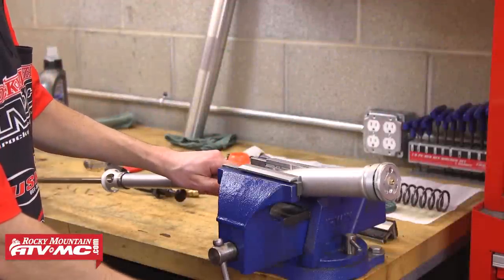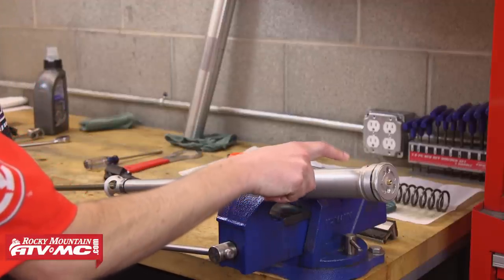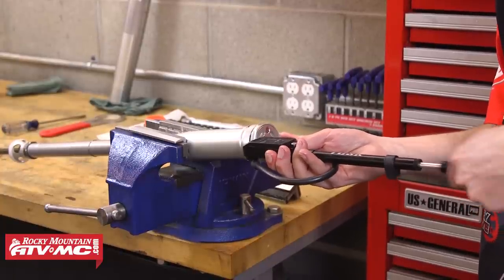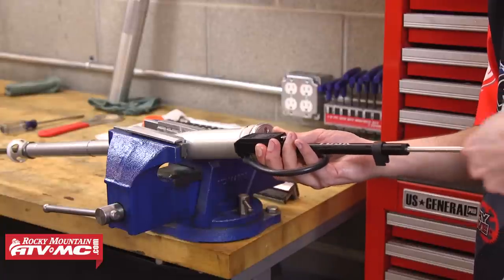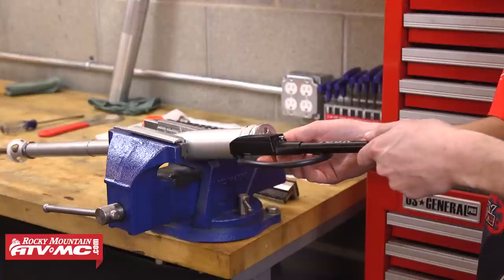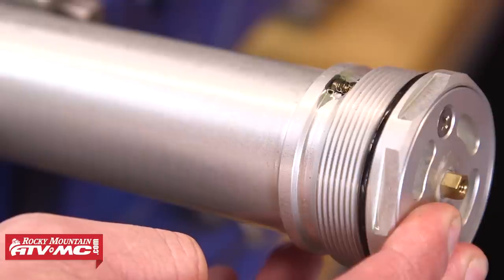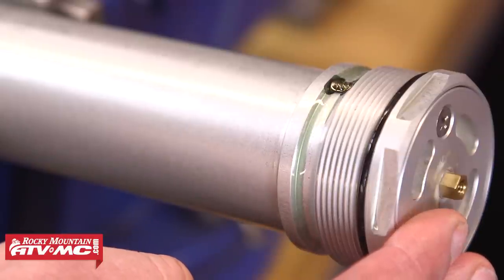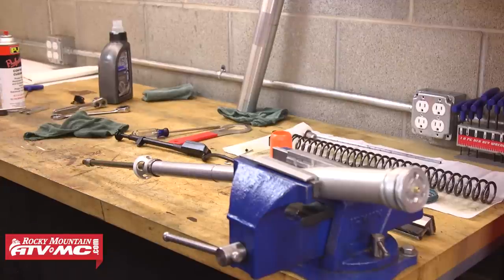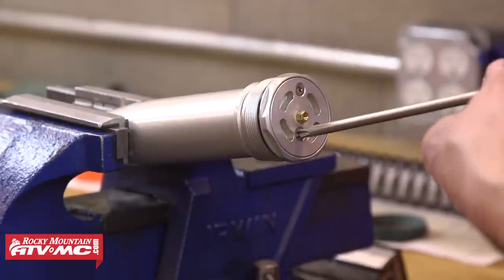Next reposition the cartridge in the vise with the check valve at the highest point so any air bubbles still in the system will work their way up and get pushed out. Go back to the suspension pump and needle and this time pump the bladder up to the manufacturer's recommended setting of 1.2 bar or 17 psi. We found it's best to go 1 to 2 psi higher because it's going to lose 1 to 2 pounds as you pull the needle out. The next step is to bleed the inner chamber by running the damper rod through its stroke — you'll notice air bubbles come out of the bleeder valve as you do that. Do that 2 to 3 times and you should also notice the damper rod extending all the way by itself after being compressed. Now move up to the cap and reinstall the o-ring and screw into the bladder access hole, then reinstall the compression adjuster onto the fork cap.